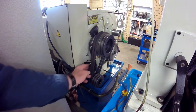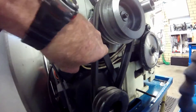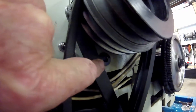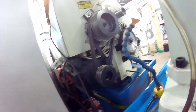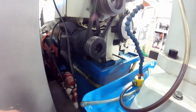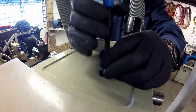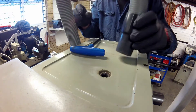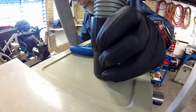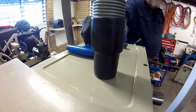With the cover off I do a quick check of the drive belts. Next I come to what I see as a major design flaw in this model — the location of the headstock sump plug is directly under the drive shaft. Because of the position of the drive belts it's almost impossible to get a suitable funnel located there to catch the oil. Having tried all sorts of tricks over the years, I've settled on this method: I undo the fill plug and remove it, then place the hose of the shop vacuum cleaner over the plug hole. Turning on the vacuum — it will not suck up the oil, but it does create sufficient vacuum to enable the drain plug to be removed without losing any oil.